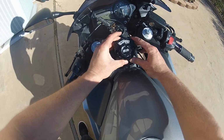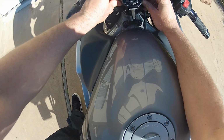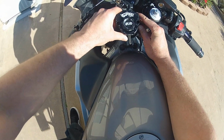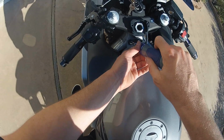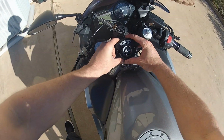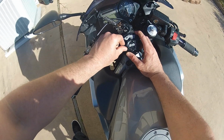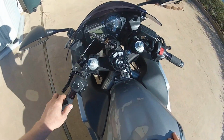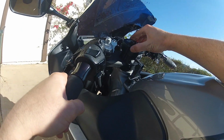Now you are going to just want to take the stabilizer and match it up to everything. Make sure everything looks okay, and it is making contact with the post mount. Looks good. So now we can tighten the post mount bolts. Alright, looks good. Now we are going to install the actual stabilizer. So you are going to want to put the bolts and just finger tighten each one in. Alright, and we want to just make sure everything looks okay, everything looks straight, good to go.